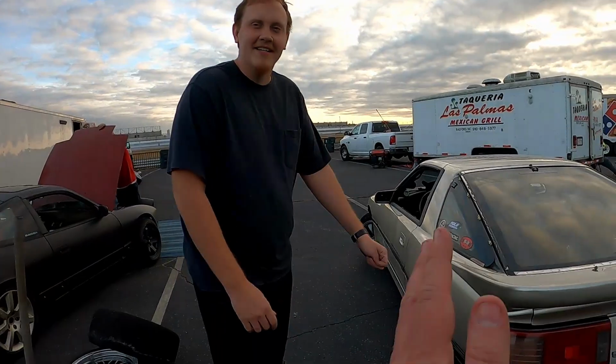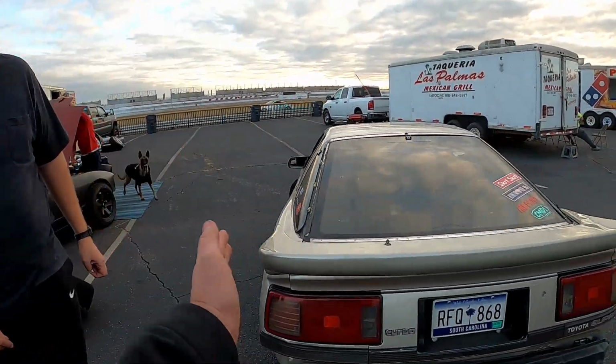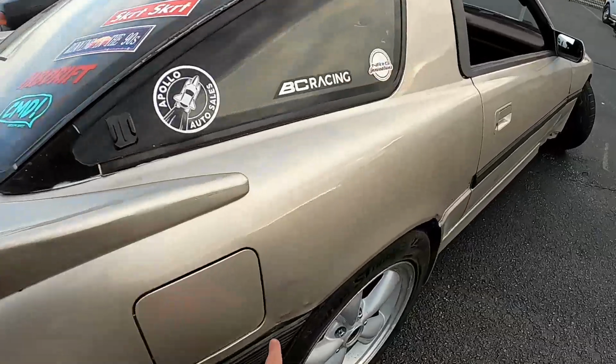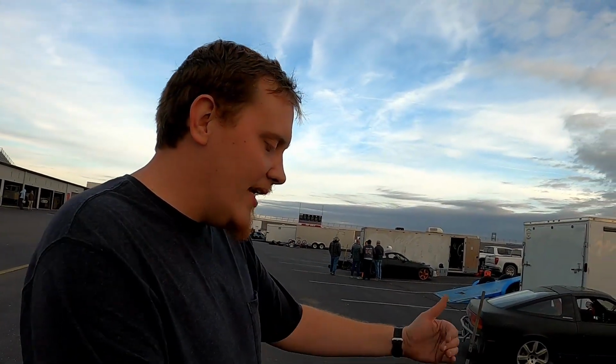So you look at this side, it actually looks really good, and then this side doesn't look as good. So the side he wrecked is cleaner than the other side. Yeah. What happened was that it's probably the rear behind the subframe. The frame rails are probably pushed over about half an inch to the right. The alignment sits right, so it still drives fine.